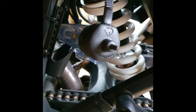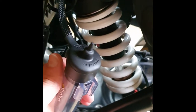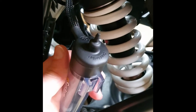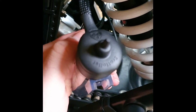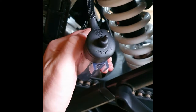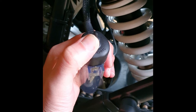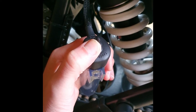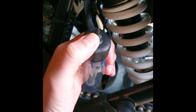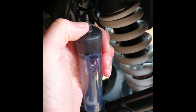Unlike the V system where the oil comes out of the bottom, this is the RMV here — you'll notice there's absolutely nothing at the bottom other than a blanking plug. So the oil actually gets pumped out the top, just here. That is basically what we need to slightly trim, because you could fit everything together and find that it would just not work. That moulded piece of plastic just needs snipping off with a pair of sharp cutters — just a tiny, tiny little bit. You don't want to take it down too far, bearing in mind those are the bits used to grip onto the pipework.